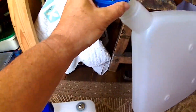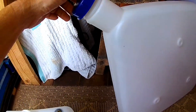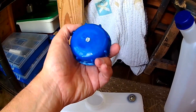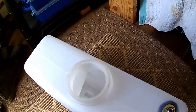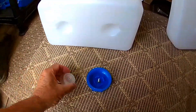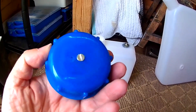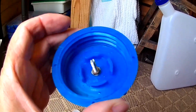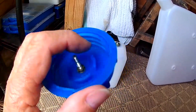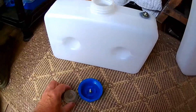Unfortunately this cap won't fit that tank and vice versa — the threads are different. My shed diesel heater has got a different size cap again. So I've somehow got to reuse this or make a washer that fits in here that doesn't block the vent hole but still allows air to be sucked in but not out. If it weren't for these stupid plastic lips I could just make a larger rubber washer and fit it right. That's problem number one to resolve.